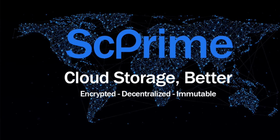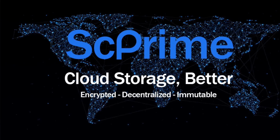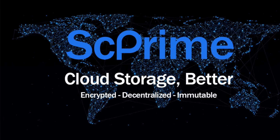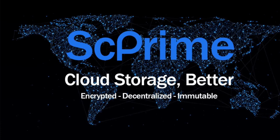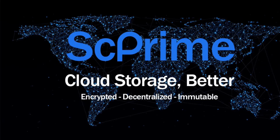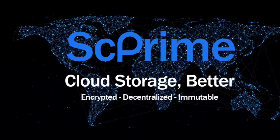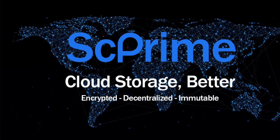Keep in mind that we're in the test phase right now, so there's not a whole lot of data coming in, really pushing the hard drives. So they won't be getting too warm at this moment. But as more data starts streaming in once the net goes live, the hard drive temperatures could go up. So keep a close eye on that and make sure they're not getting too hot if you do start playing around with the fan levels.